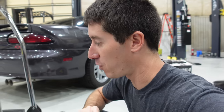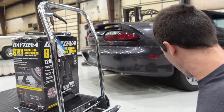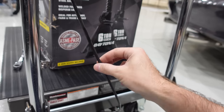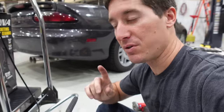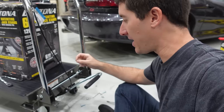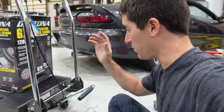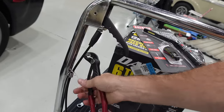Flipping the handle isn't as straightforward as it seems — we had to go a little modify. What I did was take my mini cutoff wheel and cut a little slit in the retainer that holds this cable. After spreading that out, the cable came right out. Everything reaches and the bolt holes line up again. I'm going to do a quick test to see if the handle flips down. If it doesn't, we'll route the cable a little nicer, moving it inside the little step bar. If it works, we'll just tighten down all the bolts.